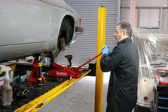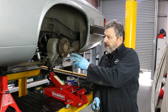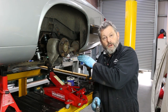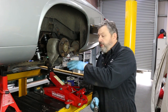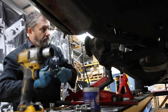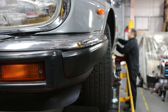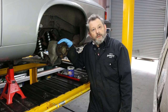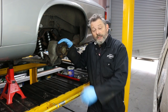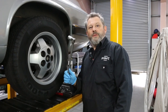I've brought the trolley jack back into play so I can jack the suspension up to very roughly its running position when it's on the road, so that when I tighten up the nuts that hold the top and bottom bushes in place, the bushes won't be under any strain when it's at the midpoint. So that's it — end of side one. Just got to do it all again on the other side, because you'll always fit these as a set. I'm going to put the wheel on and that's it, job done — always finish off with the big bar.